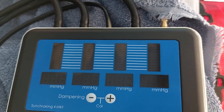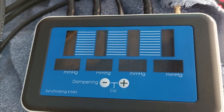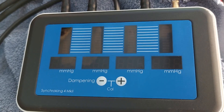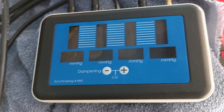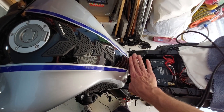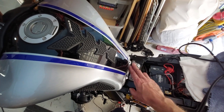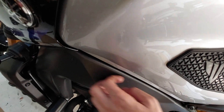The bike is back together after having pulled it apart about five times just to fix things. I even had to unscrew a sensor in order to get to one of the things — you never see anyone mention that. I got all the way to the end and realized I had a screw left over. So I had to take the tank off again. Best way to disconnect the breather hoses once the tank is unbolted: get a towel down over the area — no need to take certain things out, but do get something wrapped over it.